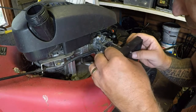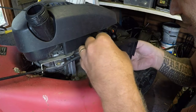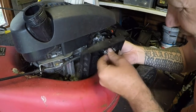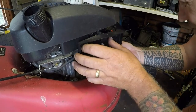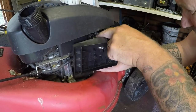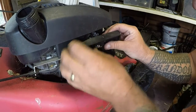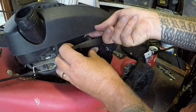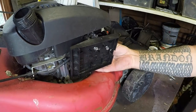and then the whole lot goes through the carburetor, through the back, and then just take a turn. And as you take a turn on it, once you get it into position, it just plops into place, which will be about there. You need to push the air breather pipe on as well. It's a bit cack-handed, but if you get the air breather pipe on first, the rest will all sort of fall into place, and then just start that off.